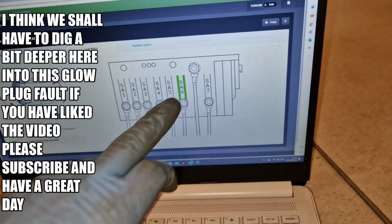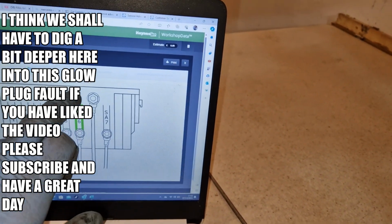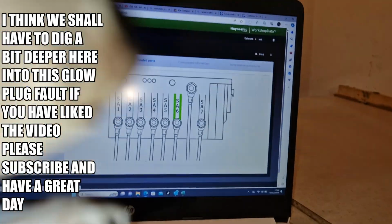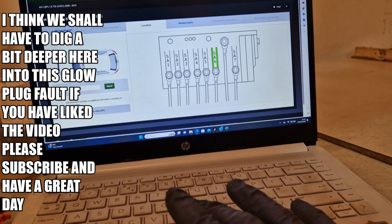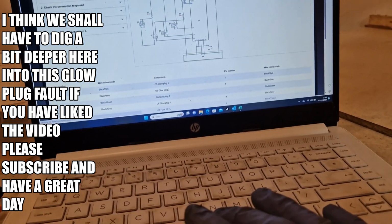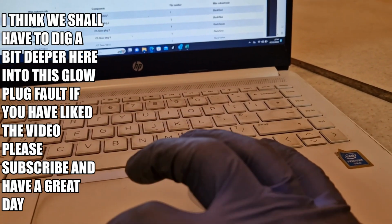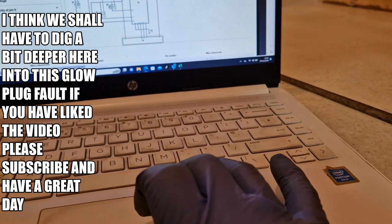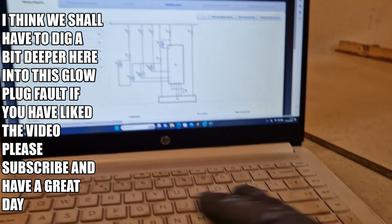Right, so that big fuse there, which is a 40 amp, I tested it there and on this buzz bar up here, it looks okay. So back to the diagram again. The fuses seem to check out okay. So we need to locate this module. It's not giving me a location on it. Right, pause here again.